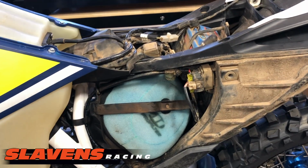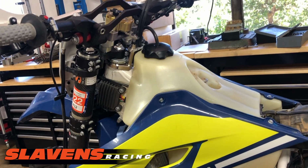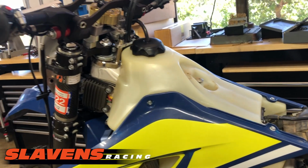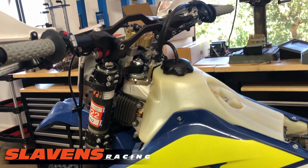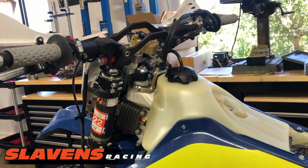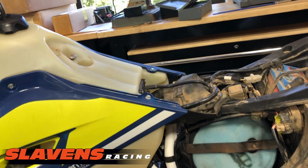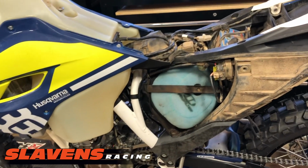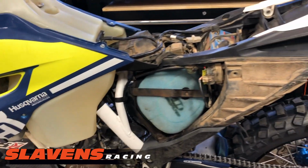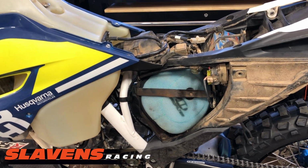First thing we pulled off the headlight so that we can get to the connectors up there for the starter switch. I jumped the starter switch to bypass it, to basically eliminate it from the puzzle here. And we looked at some of the other wiring, and it just didn't make sense that the wiring or the connectors or anything like that would have a problem such as this, where it worked 1 second, didn't the next.